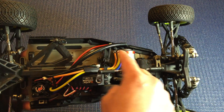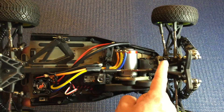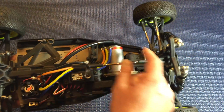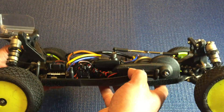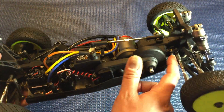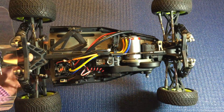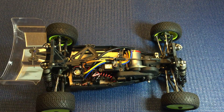With the motor, they didn't want it off to the side — they wanted it centralized in the middle. Well, that means three belts: a front belt, a rear belt, and a side belt. And with all these belts, they want them enclosed so dirt doesn't get in and foul them up. So they enclosed everything, then figured they'd stick the servo in the middle so it lines up with the front. You just see these weird design attributes — I've never seen a vehicle with the servo positioned like this, and the steering rod goes through the belts in the front. It's a strange design. It's actually kind of grotesquely beautiful from an engineering standpoint — just weird, but kind of cool, and it definitely works. There's nothing about the design that makes it drive poorly at all.